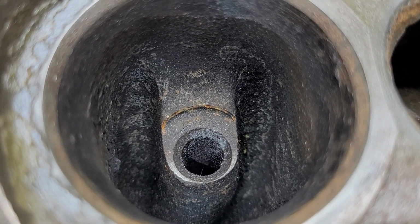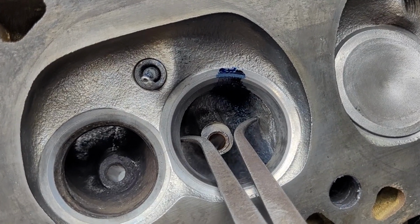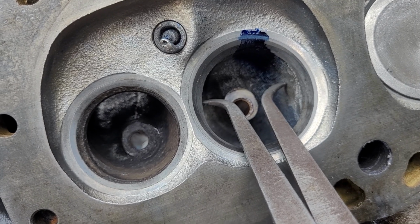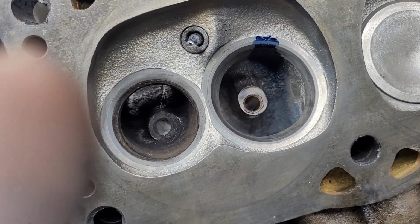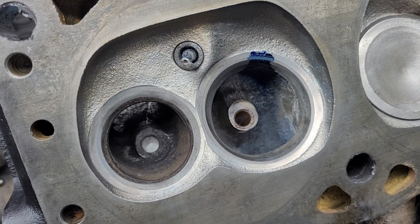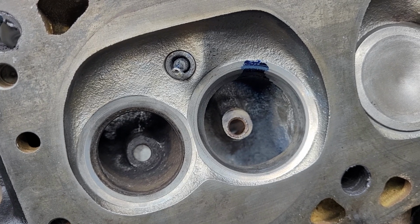All right. Let's take a look at the widths. Okay, maybe a little tough to show you guys. That's how much different you have in width. So the Magnum bowl is definitely a wider bowl. There's no question about it. It also is designed for a bigger valve, right? The 360 comes with a 188, the Magnum comes with a 1.92, so that makes sense.